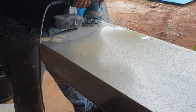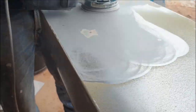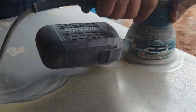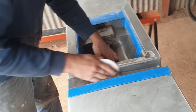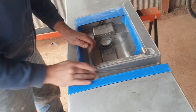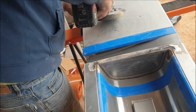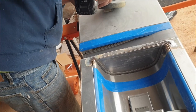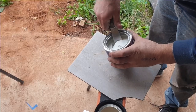Once that was done it was a matter of sanding it down — we used a 320 grit. Used the pad and just did it by hand to get the little bits and pieces that were a little bit tighter to get to. Found a few more indentations so we ground them down a little bit more — just gives the body filler something to edge to.